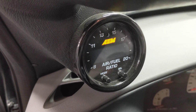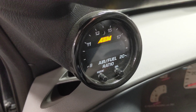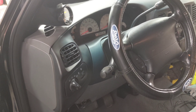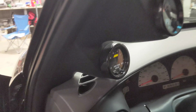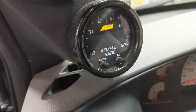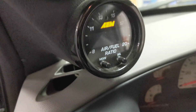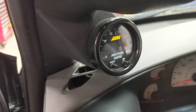This is the gauge I want to talk about today, because generally this video is about how to set up a data logging system for your vehicle. These trucks are narrow-band setups - they don't have a wideband O2 sensor. So I installed a wideband sensor into basically the mid pipe, right after the log manifold, and I'll show that a little later. Here is the gauge - this is an AEM X-Series.